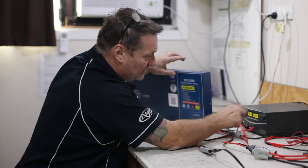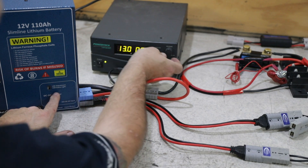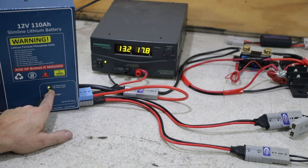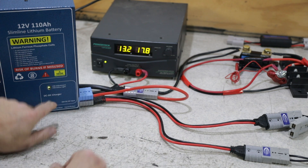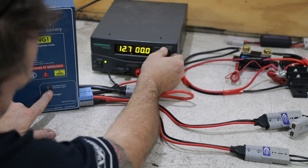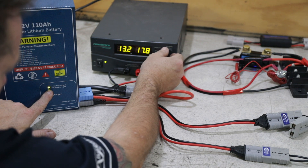As I said, in this case because I've got it going through a shunt, the negative is going into the shunt. Ultimately what happens is when you start your car the voltage will go above 13.2 volts and you can see the charger has now turned on. It turns on around that 13.2 volt mark and turns off at around 12.7 volts.